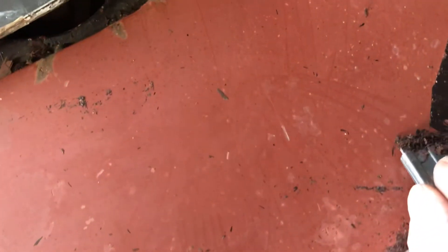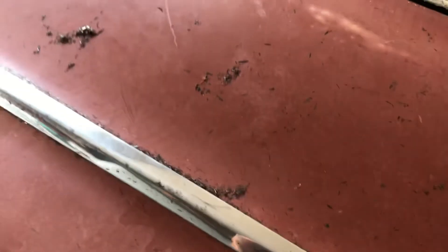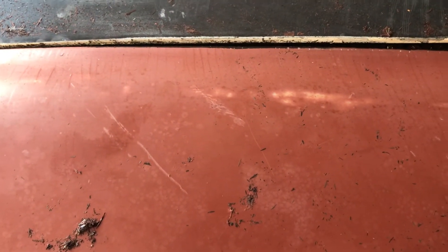The cleanup is going to be easy — all you need is a broom with a dustpan and you'll be left with just the primer. Then get a bunch of rags and some cheap lacquer thinner, soak the rags with the lacquer thinner, rub it around on that primer and it'll come right off, leaving you with bare fiberglass.